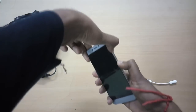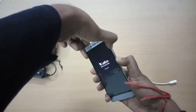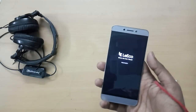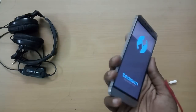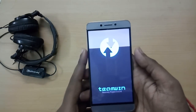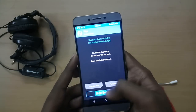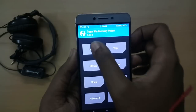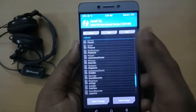Make sure that you download them and place them on your internal storage. Once you have done that, power off your device and reboot into recovery mode by holding the volume up button and the power button together. Now we're in recovery mode — select Wipe and swipe to wipe.